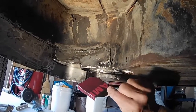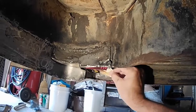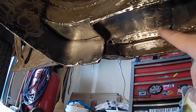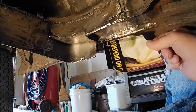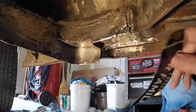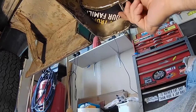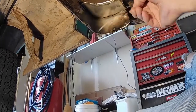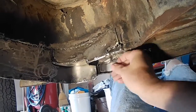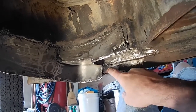I just use a piece of, I don't know, kind of hard paper. Sometimes even a cereal box paper can work. And you trace out the opening that you need. And then you cut that piece of metal out that's the same shape as this guy. You just trace it out, and then you've got your piece of metal. Then all you have to do is shape it. Same thing with this one here. That's the original shape on this one. See there? And I just cut that out, and that ended up being one of my pieces. Like that. And like that. And that's how you cover mistakes. Okay, on with the welding.